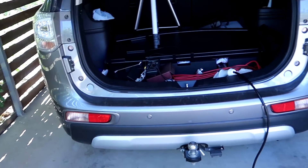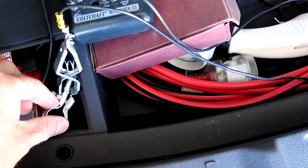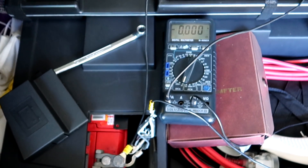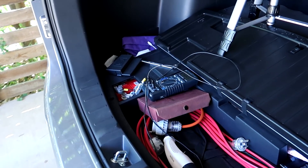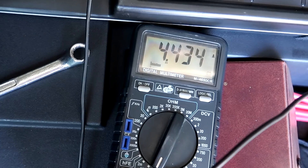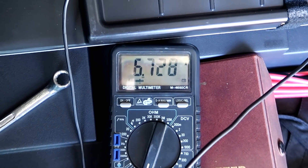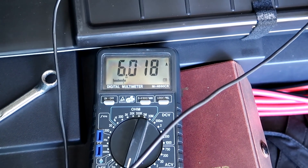Moment of truth — the car is already charged a bit and I haven't plugged in yet. I'll bypass the ammeter first so I don't destroy it — it's the only one I have. Everything back to zero and I'm plugging in the car now. Okay, we are plugged in and we have plus 8 amps into the battery while charging. The current goes down because the battery should be almost full from this morning's drive.